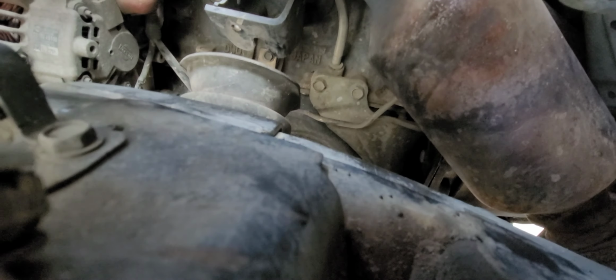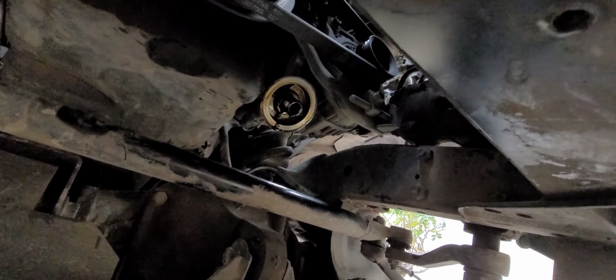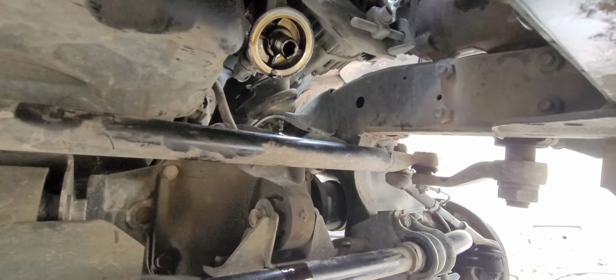And after a while it got loose. They're really not torqued in very much. I'm not gonna be able to really get much torque on this thing anyway, but it is loose. I highly recommend you guys PB Blast. Where did the nut go? PB Blast the nut, if you don't live in California, before you do, because that guy is a pain to get out. Okay, this is currently kind of a theory still, but I've got the oil filter off because I don't have enough space to get leverage on the bolt or on the nut.